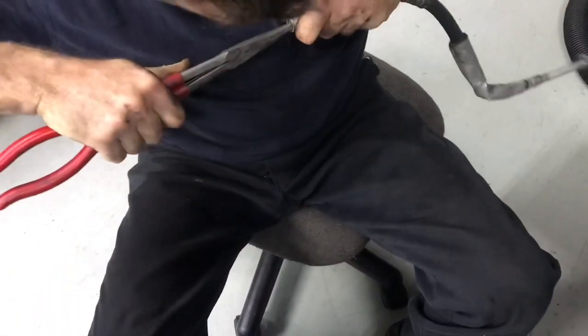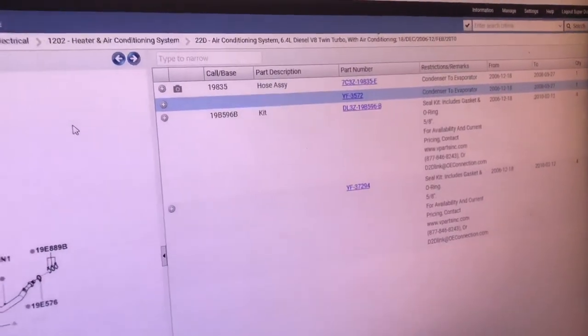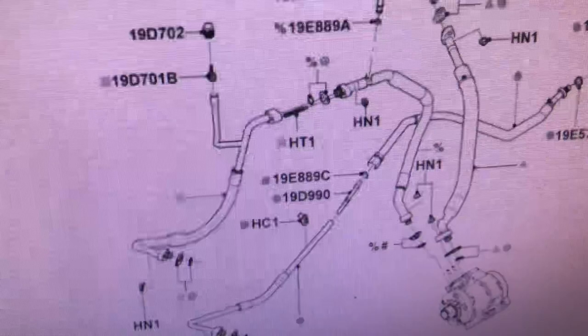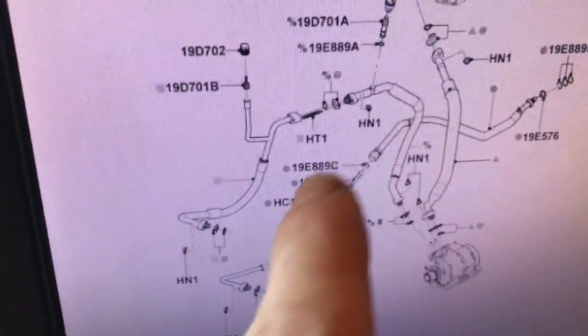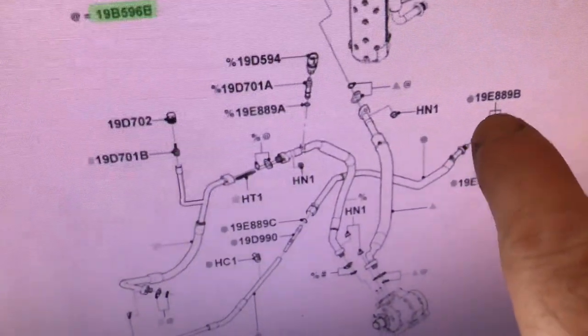Maybe I'll squeeze these handles in the vise and just pull on the wire. I mean, we could blow on the other side. So right there — hose assembly YF-3572, special order, 66 bucks. Actually 42 on this screen but we're paying a little more because we're getting it right now. They don't sell just the orifice tube separately — you can buy the o-ring and the nut but that's it — so we've got to buy the whole line at Gillis. From now on when we do orifice tubes on six fours, it's not even worth it for 50 bucks — just replace the whole line, because you can pull this line out the front of the truck if you get that quick disconnect done, change the orifice tube not even in the truck.